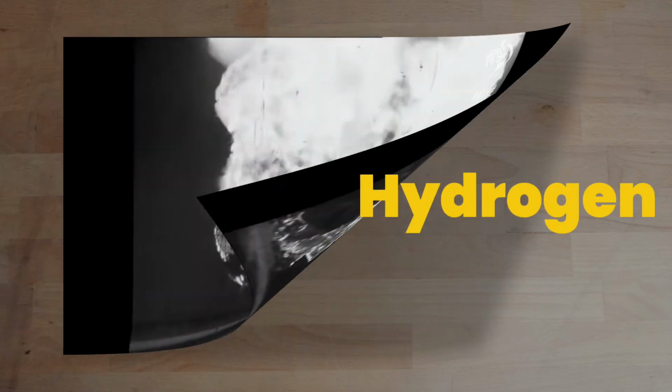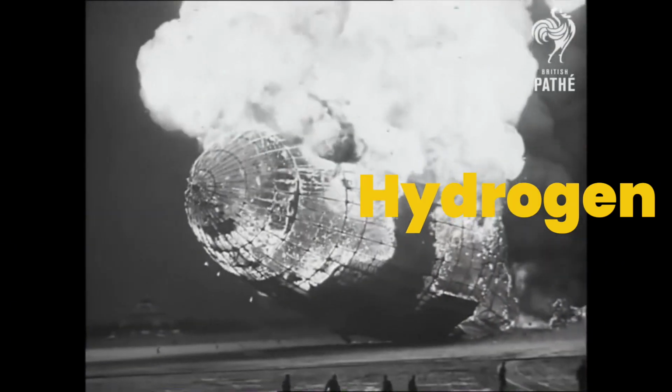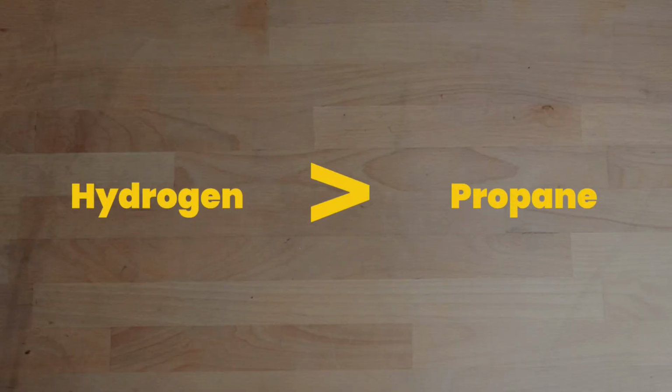Here's why. The refrigerant in your fridge is made up of 4 main ingredients: ammonia, water, sodium chromate, and hydrogen. That's the same gas that they put in the Hindenburg balloon. Hydrogen is even more volatile than propane. So think of all of the safeties that you have in your RV to keep propane from getting to igniters and flames when it's not supposed to be there. We want to double down even more when it comes to hydrogen. It also just so happens that there is an igniter and a flame built into the back of your fridge. So we really don't want that hydrogen getting to that flame. As soon as you realize that you have a refrigerant leak, do not run that fridge, especially on propane.